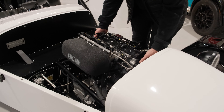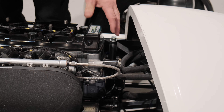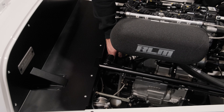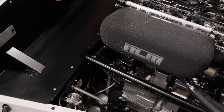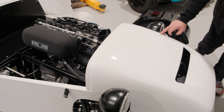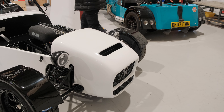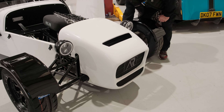It doesn't have any roll bars - we balance everything with the dampers and spring rates. It's got the new engine cradle mounts, one piece, and the engine can come out really quickly for servicing. It's got the heavy duty prop shaft and we do the little prop shaft catcher in there as well, plus the collapsible steering column all mounted up, and the cup nose cone - these all pop off really easily with a couple of clips at the side.